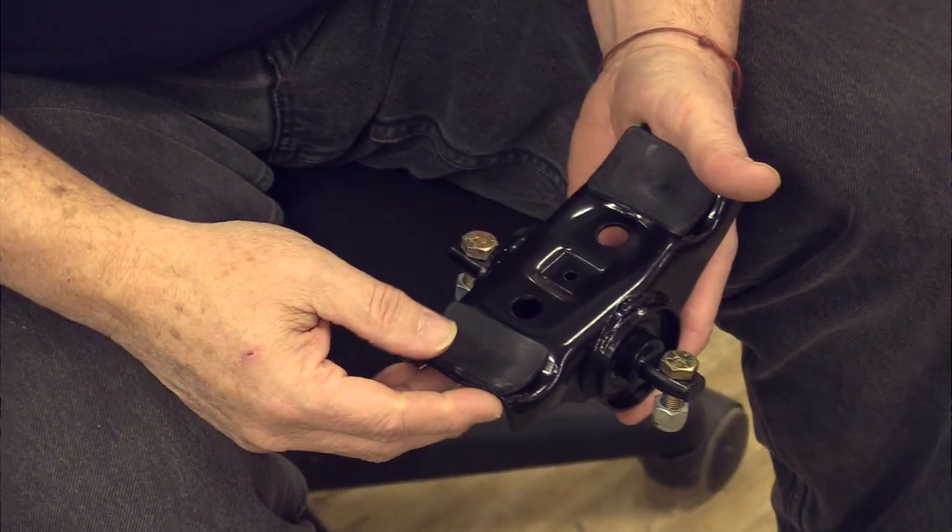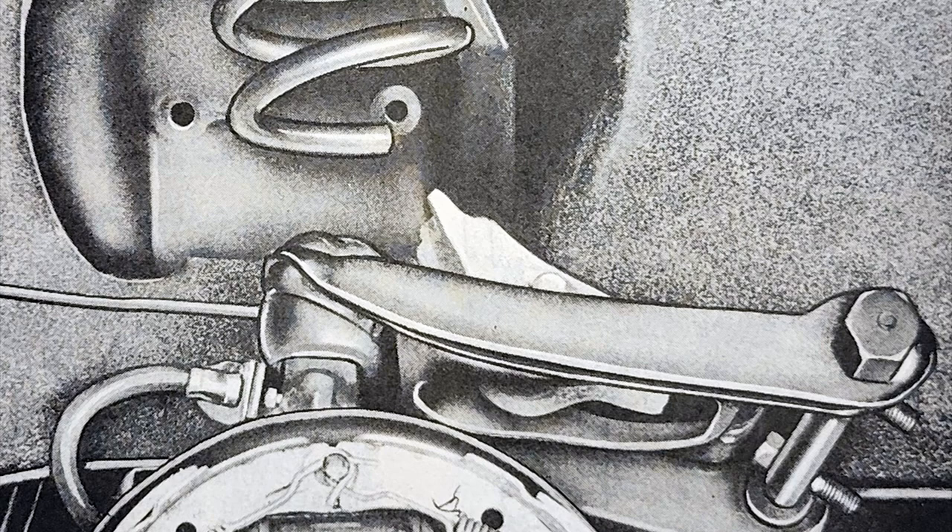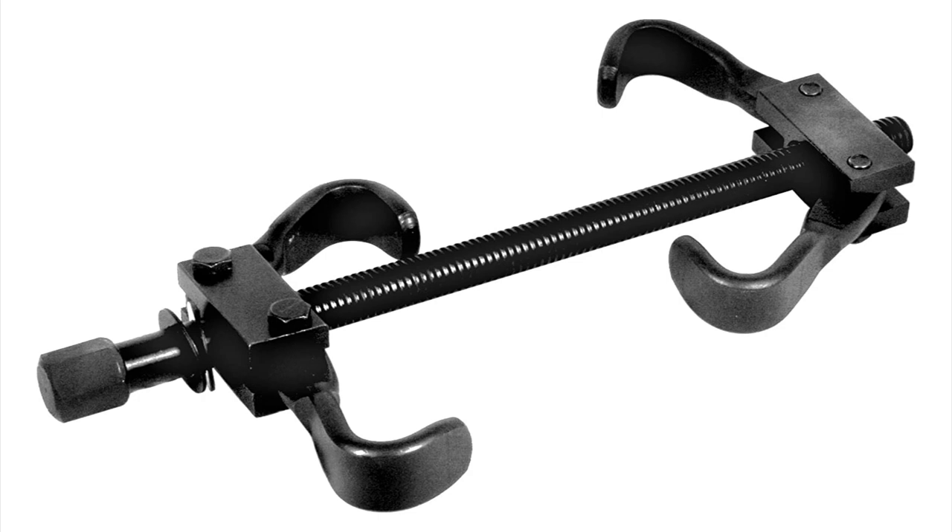This tool pulls the spring up into the shock tower, and you'll be able to pull the spring back out by taking all the control arms out and then dropping everything down — the spring will just lose tension as it falls away. Now the next one I'm going to talk about is the clamp-in style, which you can get literally anywhere at any auto parts store right now. It uses two clamps on the top and bottom to hold the springs in place and collapse the spring. The problem is the spring is under tremendous load when you pull it out, and it could possibly release if something happened to the threaded rod. I've never had that happen, knock on wood, but it can be an issue.